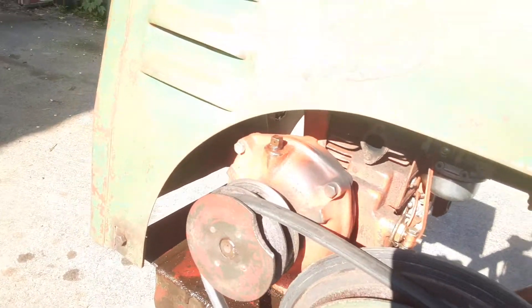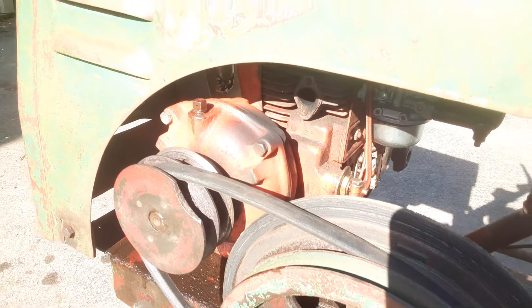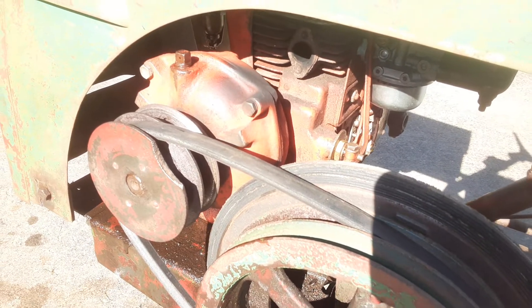It quite literally works just like a tiller friction drive — reverse belt, forward reduction box on the engine. Luckily I did find a K91 that had a reduction box on it, so I didn't have to swap the one off the old engine, because that would have required finding a crankshaft and all that.